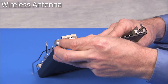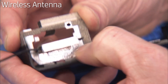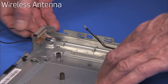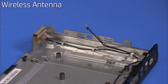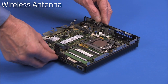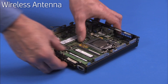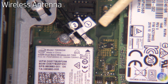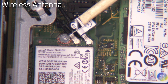To replace the front antenna, press the antenna adhesive and foil tape into place at the front of the chassis. Feed the antenna cable to the inside of the unit through its access hole and secure it in its cable guides on the chassis. Replace the motherboard assembly into the unit. Replace the wireless antenna connectors to the wireless LAN board. The antenna connectors are labeled 1 and 2 and should be connected to the corresponding 1 and 2 labeled ports on the wireless LAN board.